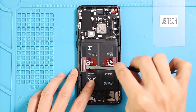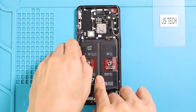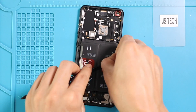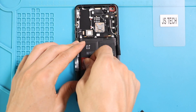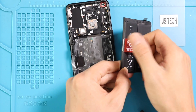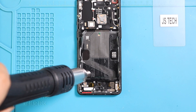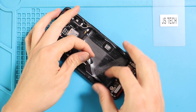Next, for taking out the battery, first loosen the adhesive on the sides and then pull them by the red tab on both sides. Finally, disconnect the tail end of the LCD extension cable plug. Move the battery protective tape to the right-hand side and peel the LCD flex cable. Be careful — there is a sticky strip on the edge of the bottom PCB. Move it aside and pull out the cable with a little heat.